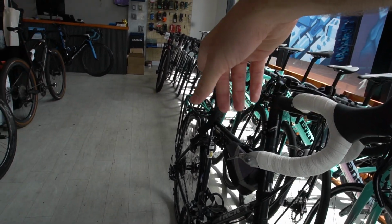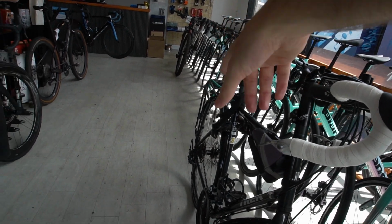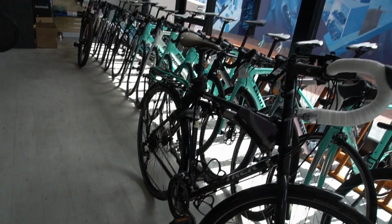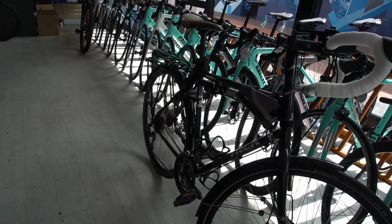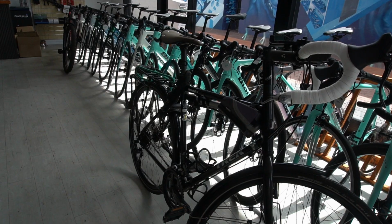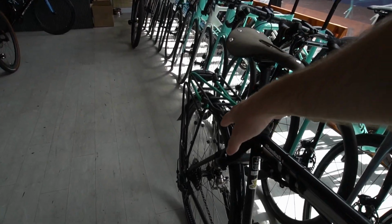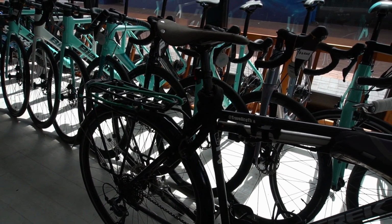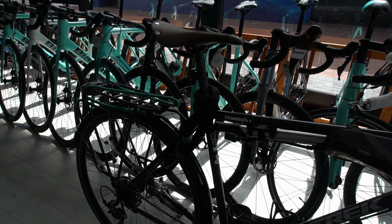Okay. What I remember from 5 years ago, the derailleur was all banged up, right? It was in the wheel and everything. It's pretty bent, yeah. But you were able to bend it back? Straightened out, yeah, and adjusted and everything. And the spokes are still a bit bent, right? Yeah, but we true the wheel, so it makes sure that the wheel's nice and true now, which it is. Other than that, no real major dramas, to be honest with you.